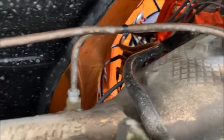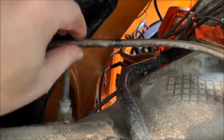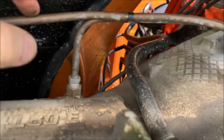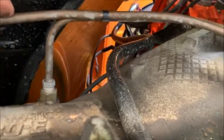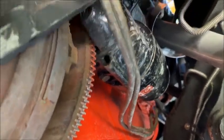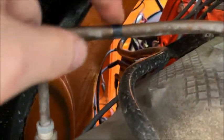For the lines I use copper-nickel, which is SAE-approved for automotive braking and fluid lines. It's also called Nikop. It's easy to form, fairly strong, fatigue resistant, and easy to route. It gets rid of any hose splices — hose splices really suck, I don't want any problems. Notice I've got bands on here that keep the lines together, keep them from rattling, and help prevent fatigue.